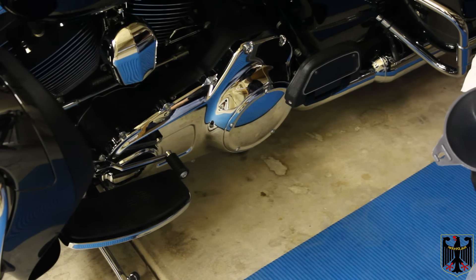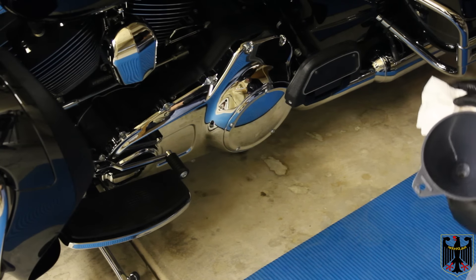Now I'm going to pull the saddlebag off and check the deflection on the belt drive. To check belt tension there's an inspection window — you have to remove the saddlebag and use a belt tension gauge set to 10. You push it against the belt and it applies about 10 pounds of pressure; the book gives you the exact deflection spec for your model. Mine deflects just about right so no adjustments are needed. While I'm in here I'll also check tire pressure — 40 PSI in the rear and 36 in the front using a high precision racing gauge.